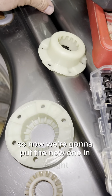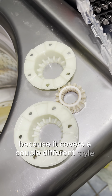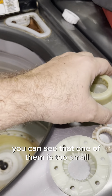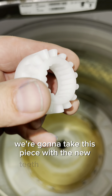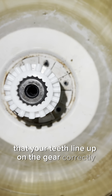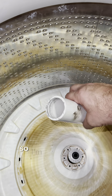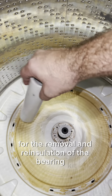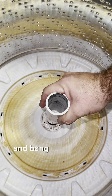So now we're going to put the new one in. In this kit you're going to get two of these covers because it covers a couple different style washers — different models. Just size it up: you can see one of them is too small and this one is the right size, so I'm going to use this one. We're going to take this piece with the new teeth and slide it on. Looking from the top, make sure your teeth line up on the gear correctly — you don't want to be smashing it on and ruining the brand new plastic gear. It is pretty tight, so I'm going to use a piece of pipe here. This actually came with the bearing kit for removal and reinstallation, but it just happens to be the correct size. I'll set it over top of that and bang down with a little hammer.